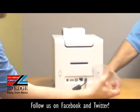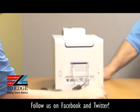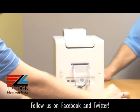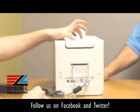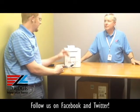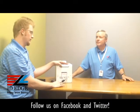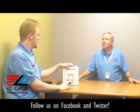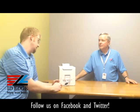Something to note — you saw me pull this off — this is the reject bin for encoding. If you have an encoder on here and it fails to encode a card, it will spit it out the back and notify you on your screen. That happens before it prints the card, so you don't waste the ribbon. Also, when you load ribbons into this printer, it all syncs itself. There's a chip in the ribbons that communicates with the printer, which goes into the driver and sets the settings according to what ribbon you have. Right now we have a YMCKO ribbon, so it will automatically set your printing settings to print full color front and back. You can always go into the driver to change it to one-sided printing. The same applies if you put a monochrome ribbon in — it will change all your settings to print whatever color you need. Those are some of the features packed into this little machine.